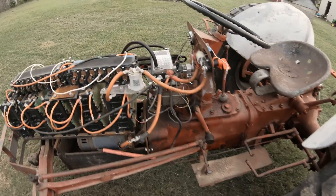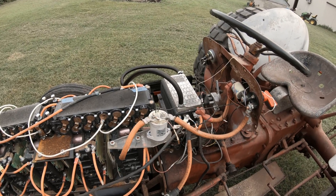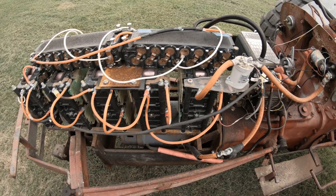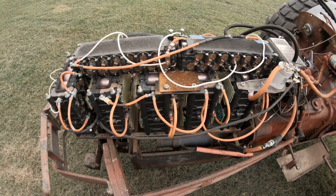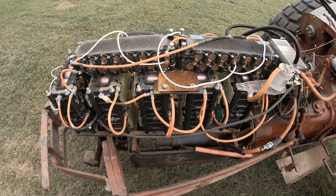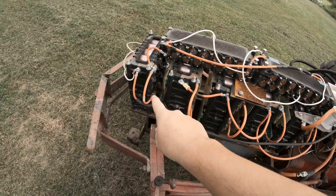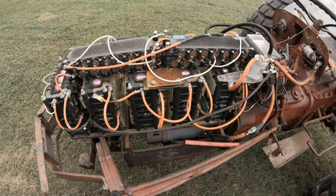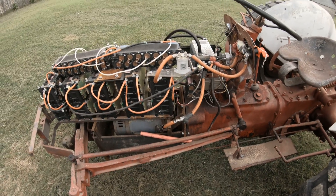Next steps will be to take the Curtis off and put the Soliton Junior on, and consider keeping these batteries — maybe changing the configuration from currently 21 in series to maybe 14 in series. I've got some options and I think I have a couple more of these modules that might balance better with some that seem better protected and have less corrosion, so maybe a short-term fix there. I'll post about that — hope you guys enjoyed, and if there are any questions throw them down in the comments.